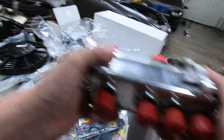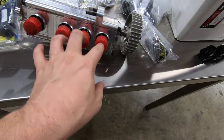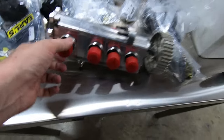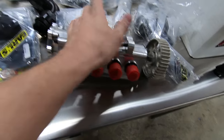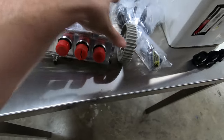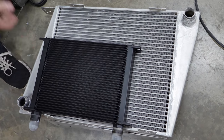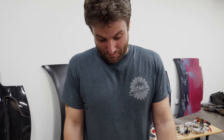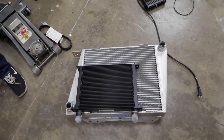On top of all of this, this pump has a lot of AN fittings. Three of these vacuum out the oil pan — those are 12s. There are three cavities on the oil pan each corresponding to these three. This is actually the oil pump — it has nothing to do with getting oil to your engine; it has everything to do with vacuuming oil out of your engine. Jarrett made a comment off camera: one of the two oil coolers is almost the size of the radiator on the three rotor, and that radiator was able to run the three rotor. That's one of two oil coolers on the four rotor — that puts it into perspective. We should try running an Insight off one of those. There's one more piece I'm going to have to wait a couple more days to get, but in a couple moments you're going to see what all of this is building up for.